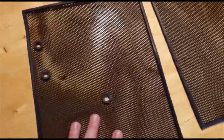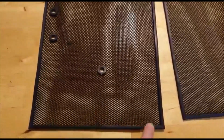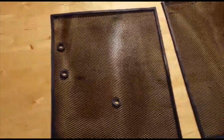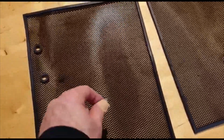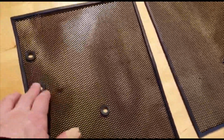And the way this works is this simply slides in, slots in quite nicely. The bottom rubber lip slides into a cavity, as does the side rubber lip slides into a cavity in the bodywork. And then you simply reuse the plastic T-mounted pegs by taking them out of the original mounting, and then when these are in place, reinserting them over the top.